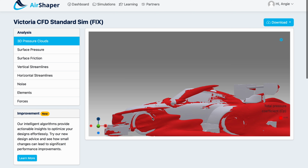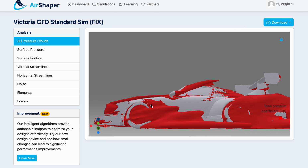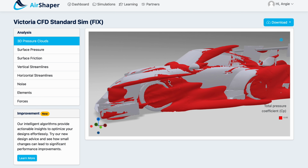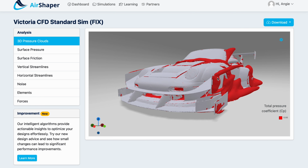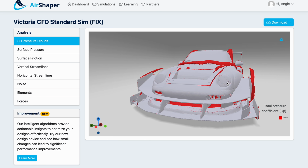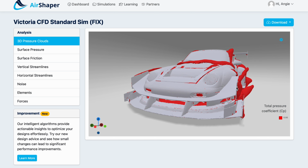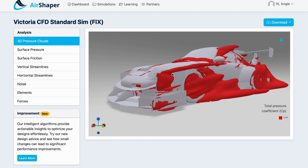So technically, when you have deep dish wheels, it creates lots of drag. The deep dish wheels, because they have that cavity between the face and the barrel of the wheel, generate a lot of drag. That's why for race cars, normally you have the turbo fans, which give you less drag. Off the bat, we've realized that the flat end plate that we used here for the diffuser is actually a wrong design. Most modern time attack cars have sort of a curvature so that when you're hitting the air basically from the front, it's guiding the air around rather than hitting it with a flat edge. So that's an inefficiency right there.